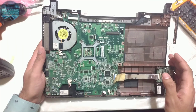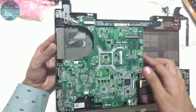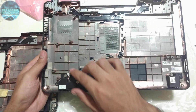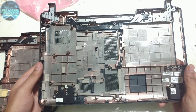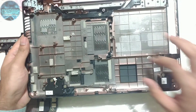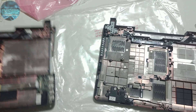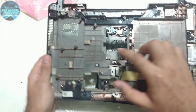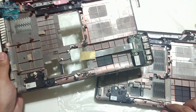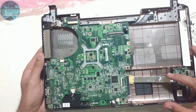Now we're going to detach the hard drive by removing its two screws, and take out the fan from its two screws. We detach the power port from the motherboard and then lift out the motherboard. The new base cover already has two speakers. I'll be transferring the power port, the motherboard, the headphone jack, and the USB ports panel. I'll fix the wires routed around the border.